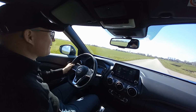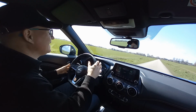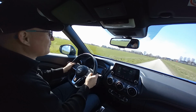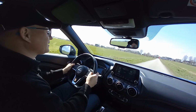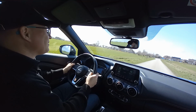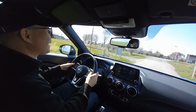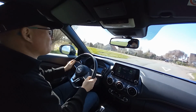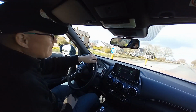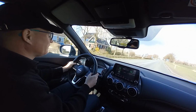But once you switch the car into sport mode, it really changes, and I like the weight and the feeling the steering has then. And even though it lacks the feedback you had from older hydraulic systems, it still is a very precise system. So that complaint about lack of feedback that you used to have in the older days, you can forget about that. Steering is still very precise, and also tire technology has greatly improved over the years. So I think those two exchange each other. What you lack in feedback, the quality and the grip of newer tires completely make up for that.